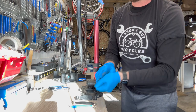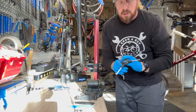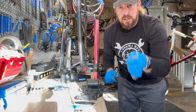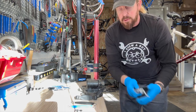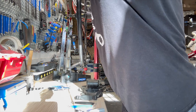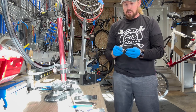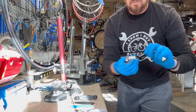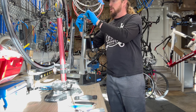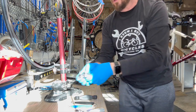In addition, some internal hubs — you don't see the nipples on the outside; you have to get them from the inside. That's what this particular spoke wrench is for. And this is a nipple driver — when you're building up wheels, that drives the nipple into the rim. For specialty hubs like a through-axle, it won't work on the basic truing stand, but it will work on this two-sided one. This adapter holds the through-axle position — you slide it in there and it locks down, holding that hub in place by gripping the through axle.